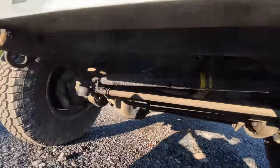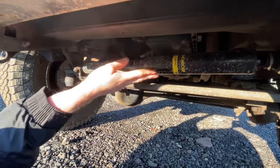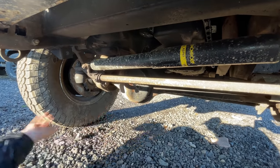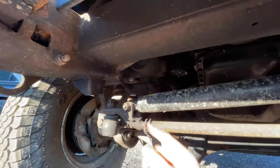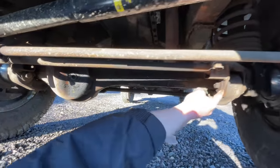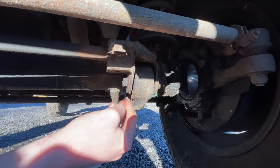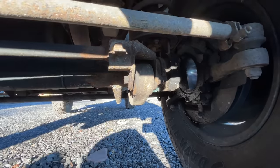Starting at the front axle, I can immediately see we've got a new steering damper - that's always great and looks relatively new, so I'd assume this car has been recently maintained. Check underneath here and make sure the actual chassis has no massive holes in it. It looks pretty neat and tidy here - nothing hanging off, there's a bit of factory paint coming off but I'm not too concerned. You can also see the radius arm bushes - pay attention to these. If the bushes are hanging out or look odd, that probably needs doing, though it's not a deal breaker.